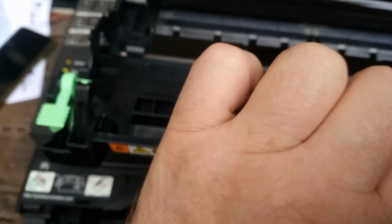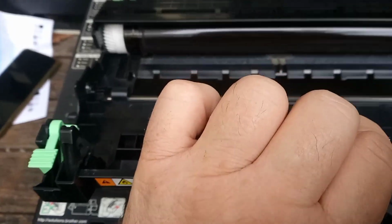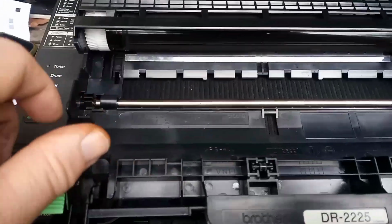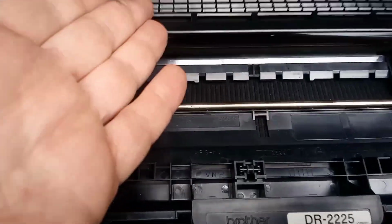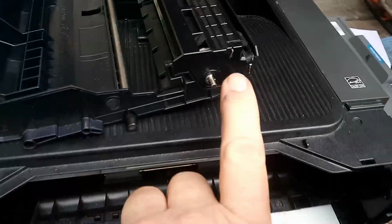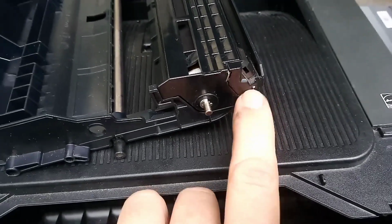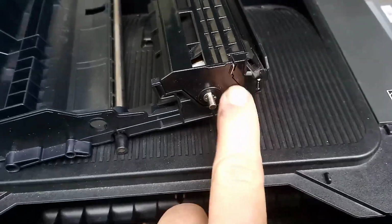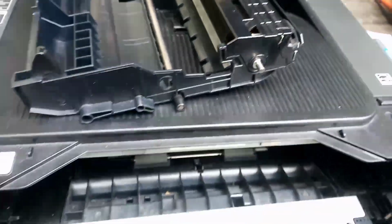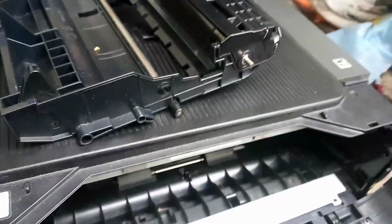You can also confirm that this is functioning perfectly by sticking another drum unit in, but I know that there's no charge voltage. So you can get no charge voltage because the electrical connectors on the side of the drum unit are dirty, corroded, so try cleaning those with some Jif cleaner. Don't use sandpaper, it's the worst thing you can use.